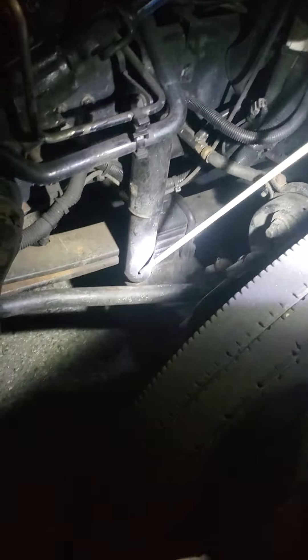I will check my shock absorber. The shock absorber is secure at the top and bottom, no crack, broken or dented. I don't see leaks. Bolts and nuts are present and tight, no crack or broken, and not missing. Rubber bushings at the top and bottom are both intact with no split or cut.